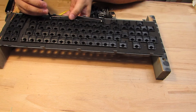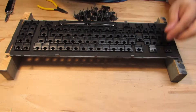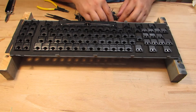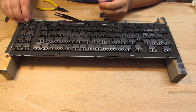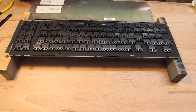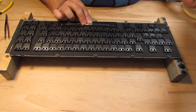Don't forget to reinstall the spacebar first. Next is to put all springs back into place. The spring for the spacebar is a bit annoying, as it won't stick into place. I put some paper tape in place to keep it down for the backside cover installation.